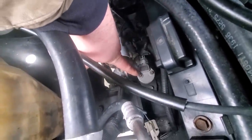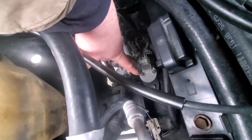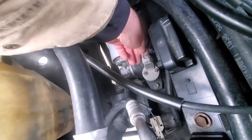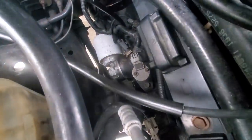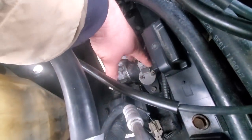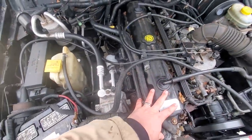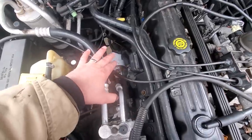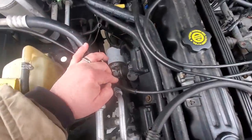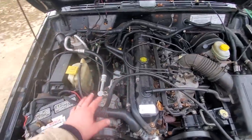To swap this out, it's really easy to get to - just these two little seven thirty-second hex bolts. You're just going to unplug the connector, unbutton this, this little gray plastic piece comes right off. Put a new one on. Whatever you do, do not take off this bolt down here - that will loosen up your drive gear and you'll screw up your timing. If you mess that up, you'll have to index it with cylinder one at top dead center on the compression stroke. It's kind of a nightmare. All you really got to do is swap the cap. I did that - I know that is good.